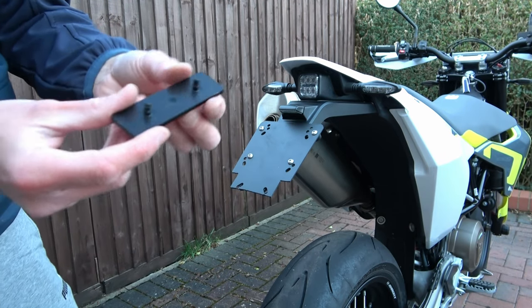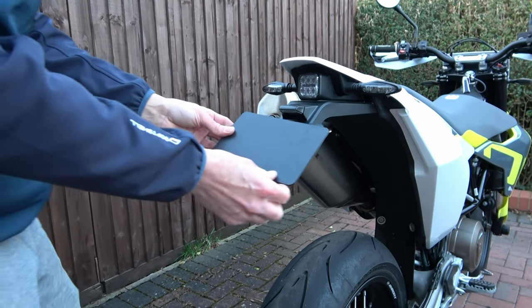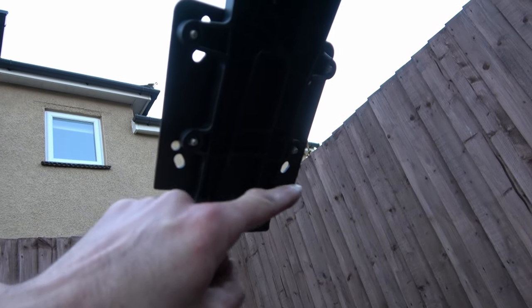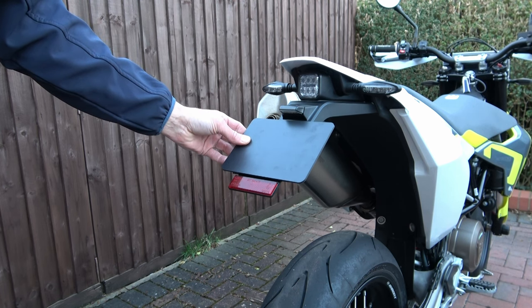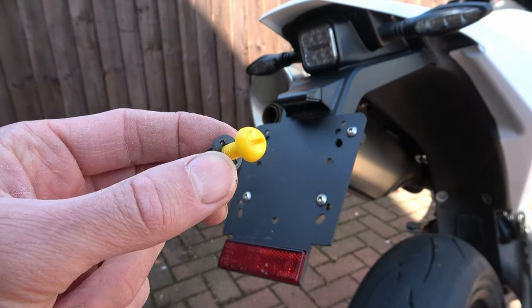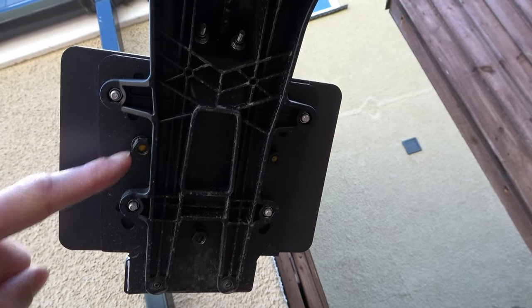In the end I removed the reflector from the original fitting and cut the plastic plate down to size using an angle grinder with a metal cutting disc. I refitted the reflector, sticking it through the two holes in the plastic plate, and attached it using double-sided sticky tape. Looking at the plate holder from underneath, you can see I cut the plastic plate just smaller than the size of the license plate — this means when looking at the license plate you can't see the plastic plate behind. I left the screws in place underneath the license plate, then to attach the license plate I drilled three holes through the license plate and the plastic plate behind using an HSS drill bit, ensuring I avoided the plastic frame of the plate holder, and used the original plastic screws to fix it into place.